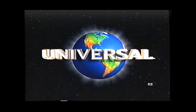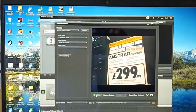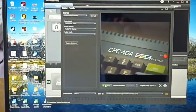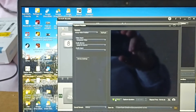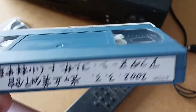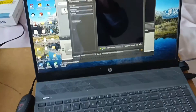Overall I'm quite pleased with the results I've been getting with this. It does what it says on the tin. Back to that Amstrad tape — this is it now with the Techside and the Arcsoft software, and you can see it's very good. I have had to tell it whether it's PAL, NTSC, or SECAM within the drop-down boxes in the software. So when I said there's no setting up, that wasn't totally right — there is a minor amount of setting up where you set the video standard in the software drop-down boxes, but you don't have to go into the operating system.